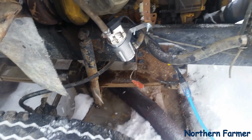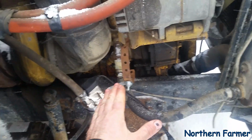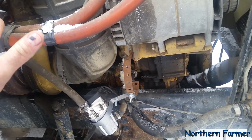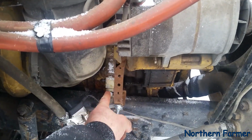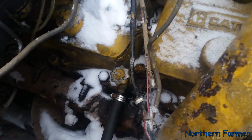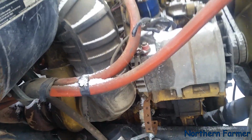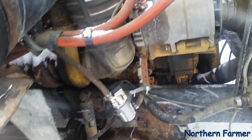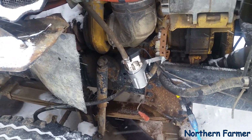So I figured I got an air leak. The directions say that you want to have it at the lowest point on the block, and then no more than about a foot rise before the hose tapers off. I think it'd be better, this is going from the block drain to the top of the head, right there where there's a valve. I think these would be better off to go through your heater lines. Tap into your lines with a Y, but I don't know.